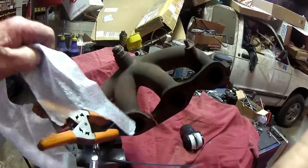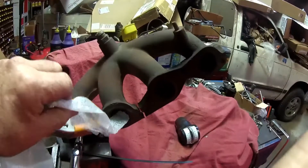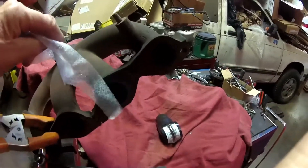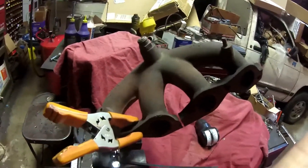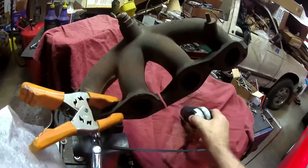Here's what we've got: the piece of paper does suck in on the cylinder next to it, showing we have a vacuum there. On the other cylinder, you can see the buffeting that blows the paper away — we actually have pressure created on those two cylinders. The way the stock manifold works, it only scavenges on the cylinder next to it and the other two cylinders have pressure.